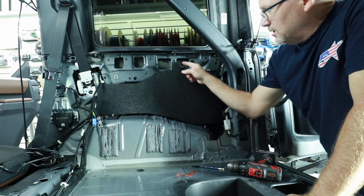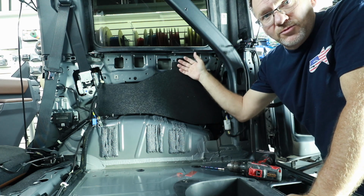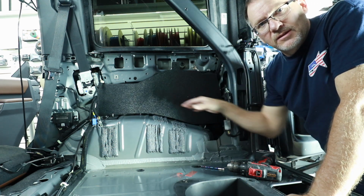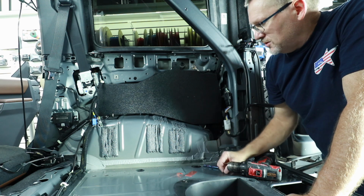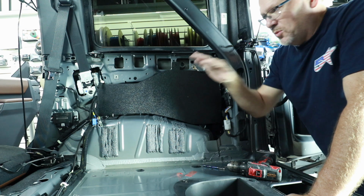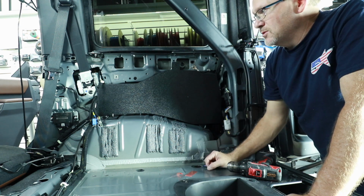What I need to do is flare the end of this so this screw will fit flat, and then put 2, probably some M4s into this so that it all is bolted together, and then this will be my amp rack. I'll get my amplifiers mounted onto this. We'll put the side panel in to test fit it to make sure that it'll do what we need it to do.